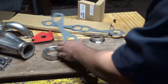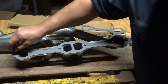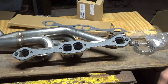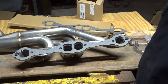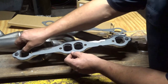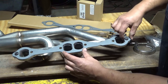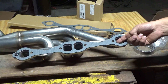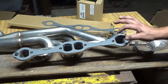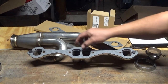Here's the gaskets they came with, and this will become relevant in a minute. As you can see, they fit pretty good - pretty close. Maybe a little bit off right here, but nothing to worry about. I'm only talking about that because I'm going to compare this gasket to a stock head to see how the gasket lines up with the stock head, which kind of shows how it lines up with the header itself.